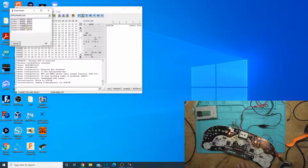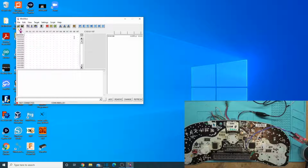We will swap over to one of the problematic ones just so I can show you programming on it real quick. I'm not going to record all of it, just get it put together. And then we will try this Trailblazer microcontroller on one of these. We'll see what happens. Okay, so this is the new board. This one, if my memory is correct, gave me a lot of problems programming, and I know it's the one that none of these LEDs are working on. I think it's a little chip hiding underneath there. I did reflow those. I did not check traces on this, though. So this one's also going to be my test subject for putting the Trailblazer microcontroller on.